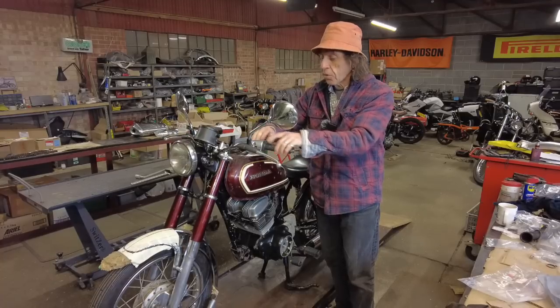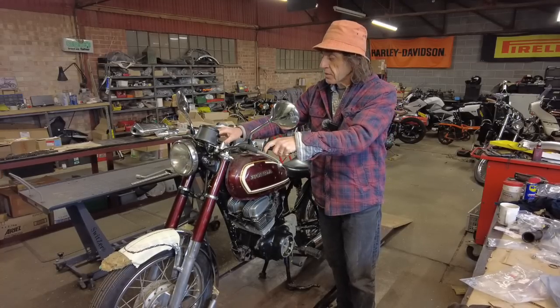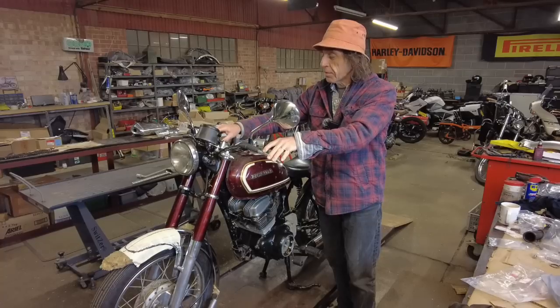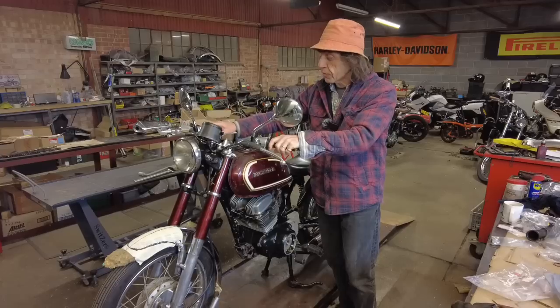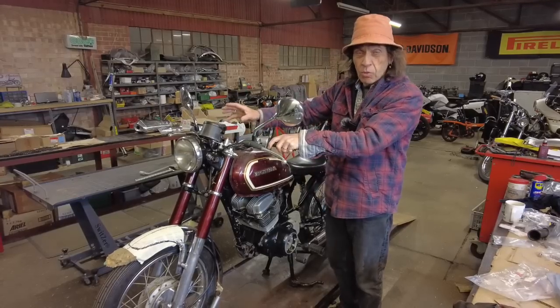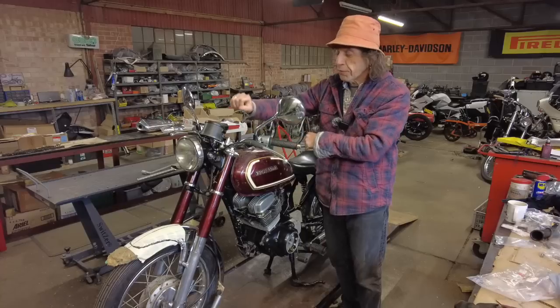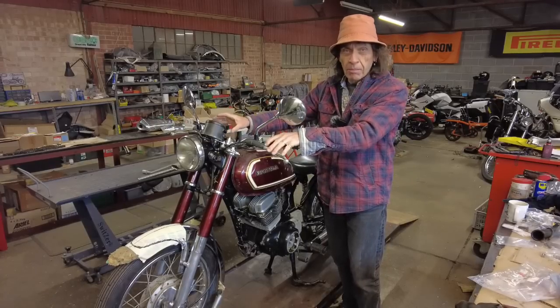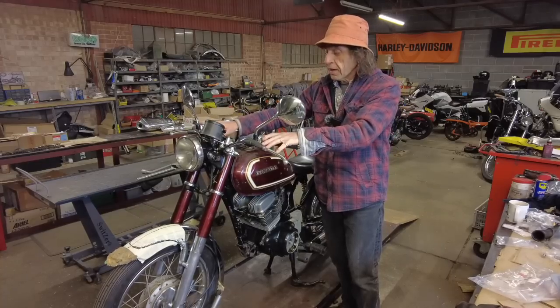And the main reason I've got to chop that is because if I put this on the end, the standard throttle cable and clutch cable and brake cable are right on their limit, and I think if I turn the bars fully, the revs would go up, and you need to always check that when you do a custom build, that when you put full lock on, the cables don't get pulled and get actuated. So that's all the right length.